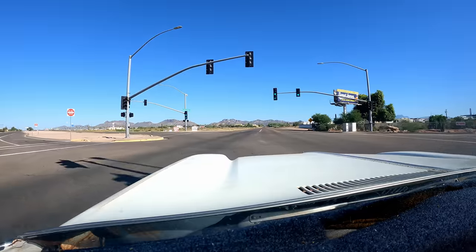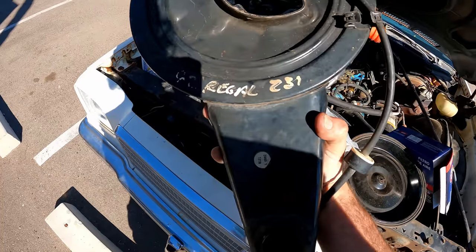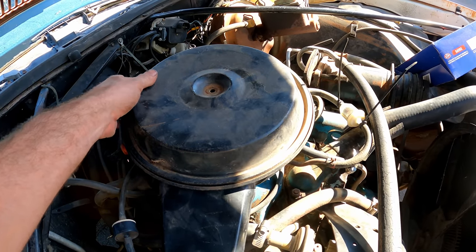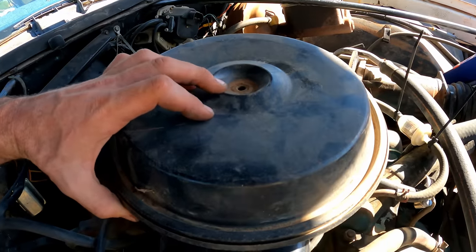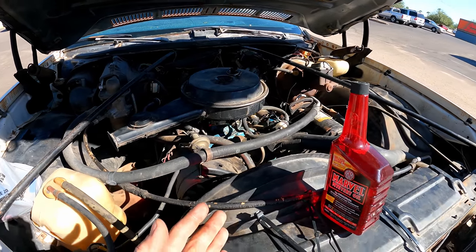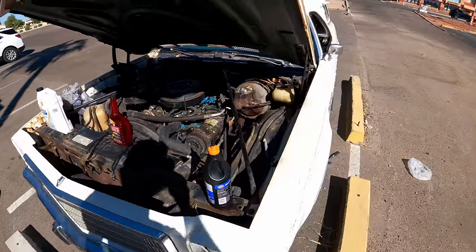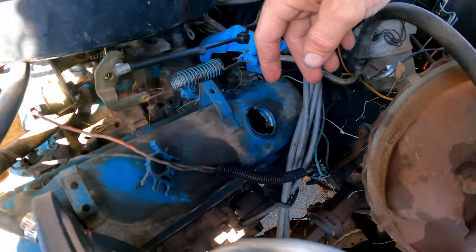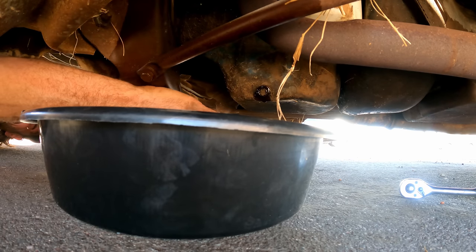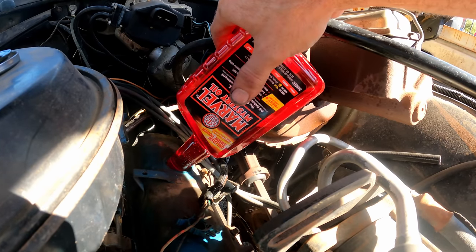Purrs like a kitten. It's easy finding the proper air filter - it says right on the bottom '82 Regal 231.' The 3.8, right? Still don't even know what engine this is. We'll look through that guy's paperwork later, or check some engine numbers. Now I was considering doing an oil change - got the oil and filter, heavy-duty diesel Rotella, high zinc content. But you guys saw how clean the oil was. So we're gonna drain a quart out of that and add about three-quarters of a bottle of Marvel Mystery Oil. Try to loosen up the lifters - you know, it's probably the camshaft, who knows. Call that about a quart, and we'll replace it with a bottle of Marvel Mystery Oil. Let it work - it's magic. Either gonna be the best thing we did, or the worst thing we did.